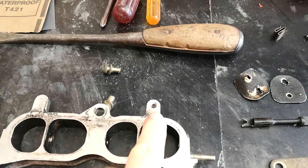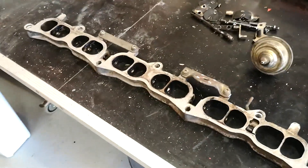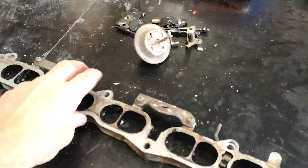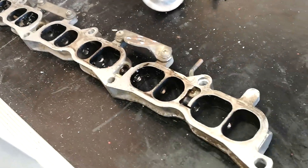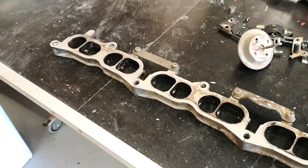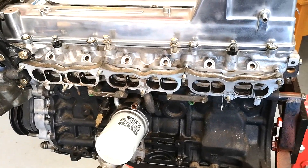My plan was basically to join it back together with those plates and use it as a spacer in behind the manifold. I'd be interested to know what other people have done. The butterfly system is all disassembled. This actuator was spot welded onto this bracket, so I drilled out those spot weld holes so I could use that bracket again and join it back together. My only question really is those holes that the main pivot shaft ran through - I'd be interested to know what people have done with that. In the end I might have to get a whole new item laser cut or water cut to replace it. So that's it sitting back in place on the motor, being used as a spacer. Needs a bit of a clean up if I'm going to reuse it.